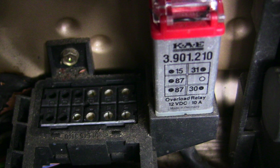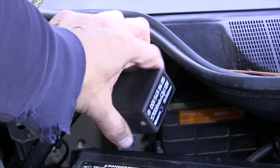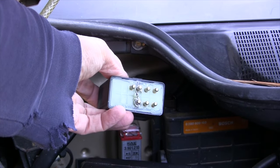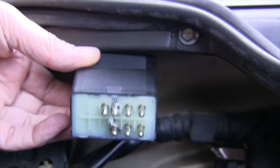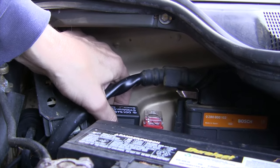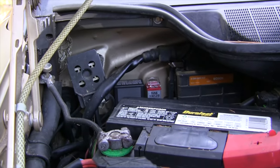Notice the rows of contacts inside the plug — three in the back and four in the front. The six-cylinder cars have two extra pins. Back under the hood, remember to turn the relay around correctly, press it in tightly, and notice that the fuel pump should start to run continuously.